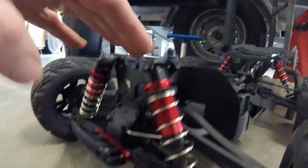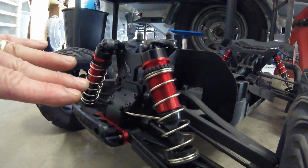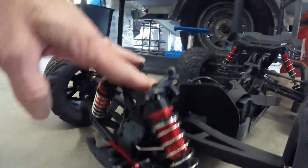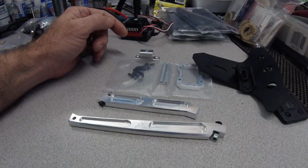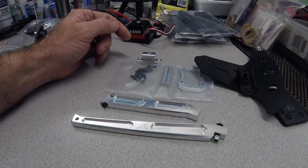Suspension, I absolutely love these V3 shocks. I do absolutely no upgrades to them at all. I like the stock oil. It's 1000 CST, and the stock springs are spec, and they just work killer. I'll put on a 16 tooth pinion, either Robinson's Racing extra hard, or the Techno pinions are also really nice from what I've been told.